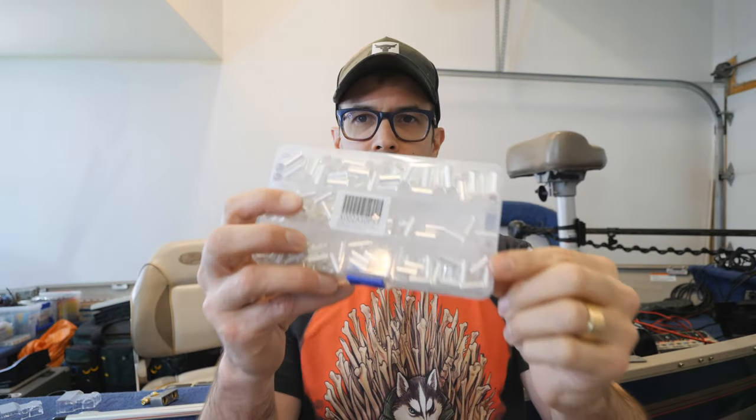Be warned — you cannot just throw the wires in here and use an Allen key to tighten them down. You need to use ferrules. Ferrules are basically little cylinders that you put the wire into, and then you insert the entire cylinder and tighten it down, which crimps down the wire. So it's very important that you have these. I'll have links in the description to the ferrules and terminal connectors. Ferrules are used on trolling motor connectors that draw up to 60 amps, so you know they'll work for your boat, no problem. They're made out of tinned copper, so they are corrosion resistant. So let's go over to the battery and I'll show you what I've got and we'll go ahead and install this.